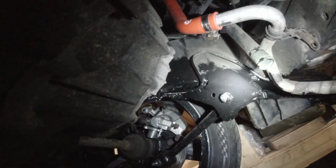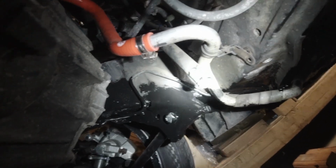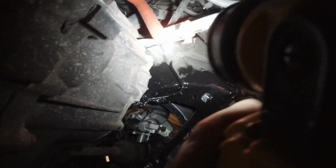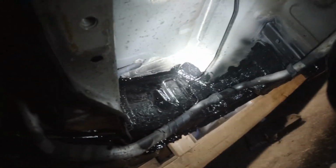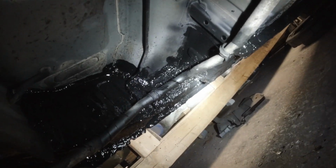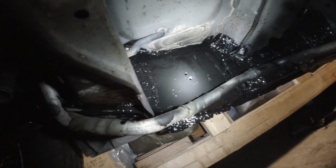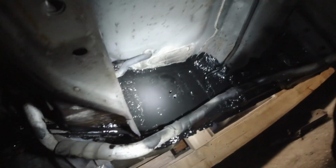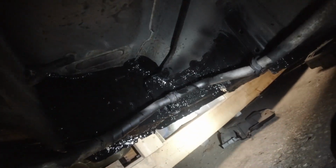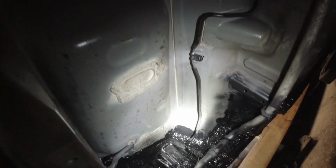Coming to the other side, we've done some more repairs. All up there. All that's been rubbed back down to bare metal, cleaned. And again, we've done the same over here. Gone right down, cleaned all the edges off, cleaned all the old sealer off, all the old paint back to bare metal. And all that's now been painted. Again, that's on about its 4th or 5th coat. I've just given it the last coat now. So that is now ready for Sunday when I put the tank back up into this hole. Yeah, this hole. Tank lives here. Forgot where the tank went then for a minute.